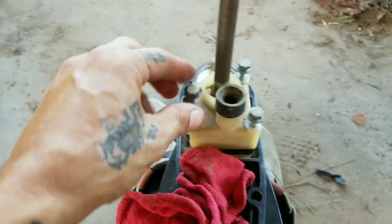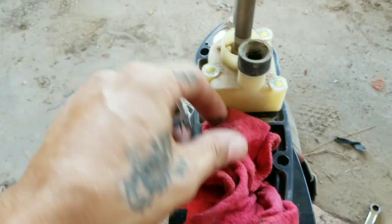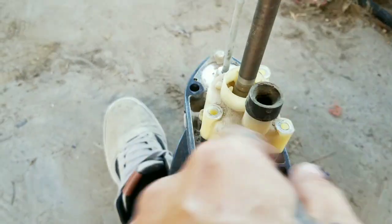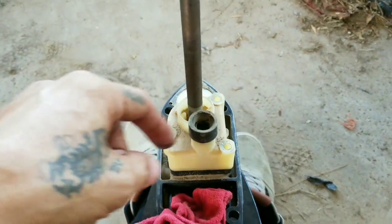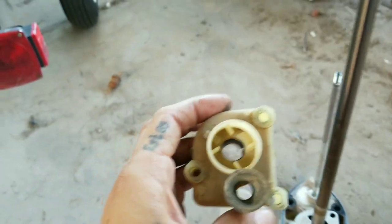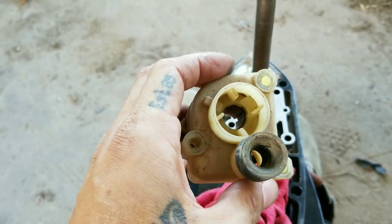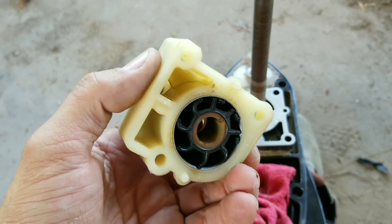Alright guys, so here it is. I think one of my subscribers just left a comment here. Always when you remove this thermostat housing or impeller housing or whatever you call it, make sure what side the paddles are rotating to. I had someone tell me, obviously we do this for a living, that the impeller doesn't always rotate clockwise. So if it was like this, let's take it out.